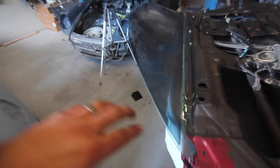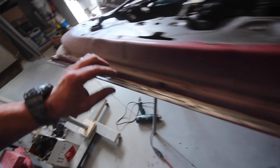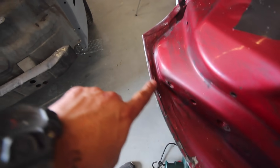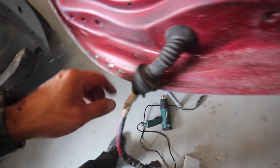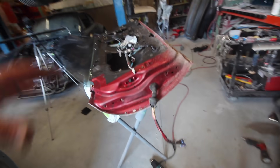I want to finish cleaning these doors up and taking the tint off. If you remember in my other video, I flipped these doors over and had an issue with a little bit of rust down here and the seam sealer kind of messed up. So while the door is flipped over, I actually want to dig all this back out and reseam seal it. It's had a door skin on it before. You can still see the door is still kind of damaged — nothing I can really do about that, but I can do something about this shoddy seam sealer work that's actually rusting. I'm going to take care of this, get these doors squared away, and then flip them over and start blocking them.